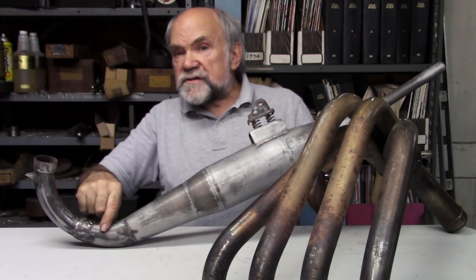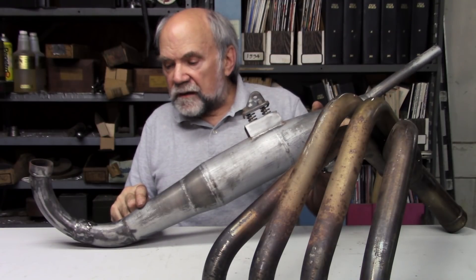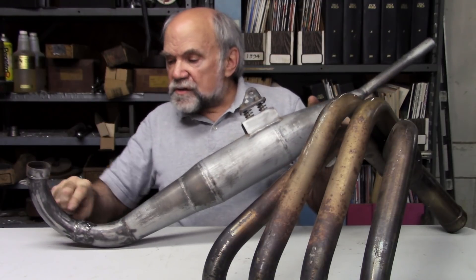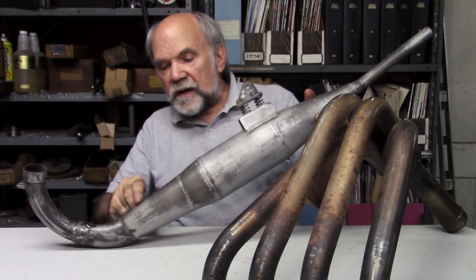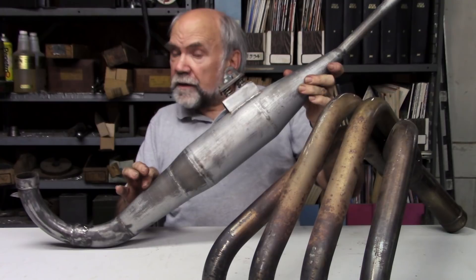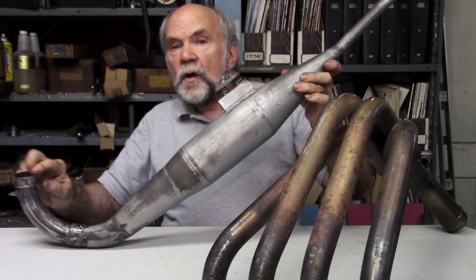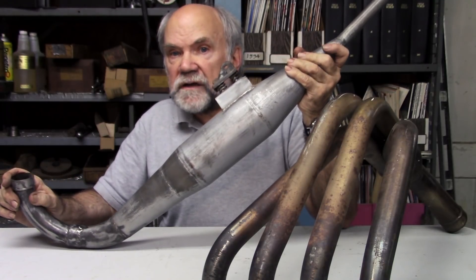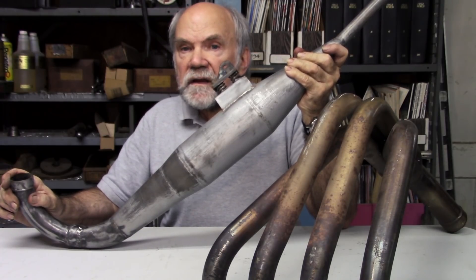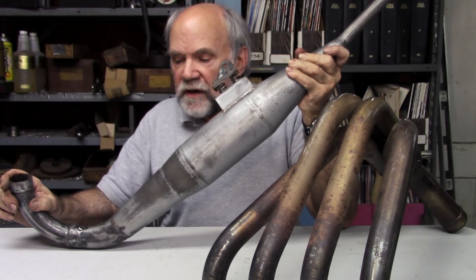When the pulse encounters the widening part of the pipe, the exhaust gas can expand somewhat. And when it does, it sends a wave of expansion back to the cylinder. So the whole time that the exhaust pulse is traveling down this widening part of the pipe — which I like to call the horn — it is continually sending back a low-pressure signal. What that does when it reaches the cylinder is it increases the pressure difference across the transfer ports, and thereby helps to pump fresh charge into the cylinder from the crankcase.